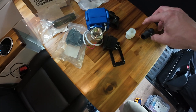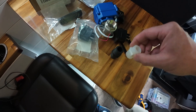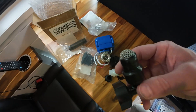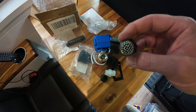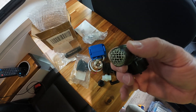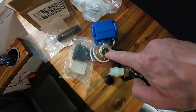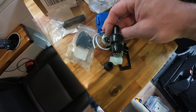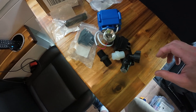I got this nice little plate so I can cut a hole, have a little more room to work, screw the plate in, and once it's wired up snap it into there. On one side of the valve we'll have one fitting, and the other side another fitting where it connects to the tank. Then I made this little 90-degree turn, and I do this on all my plumbing terminations that come out of the bottom of the van — I take a little stainless steel screen and bend it around the end of the pipe. This keeps mud daubers, bugs, and other stuff from going up into the piping and jamming the valve.